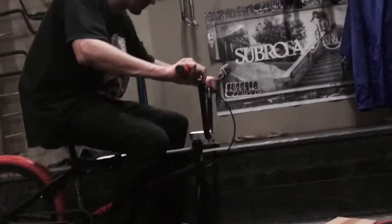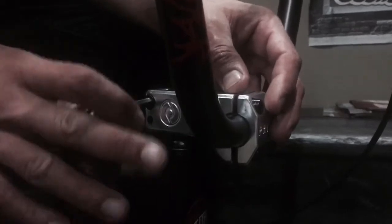Try different things out and see what you like. You're going to want to snug up the side bolt just a little bit so that your bars aren't turning on you. Then, once you've got your bars in place, you're going to want to tighten up the bolts in an X pattern, starting from something that you can remember. I always start on my right — I'm right-handed, so it makes sense. Make sure that both sides are evenly tightened. If the top are slightly skinnier, you're going to want to tighten up the bottom more or loosen the top. Give it some slack.